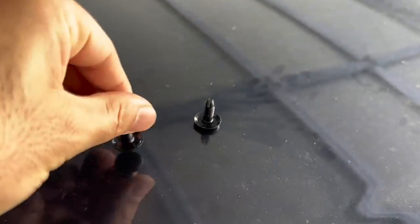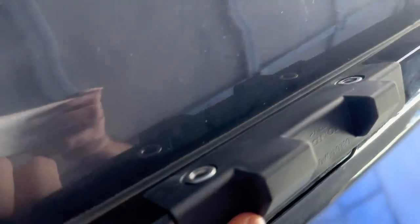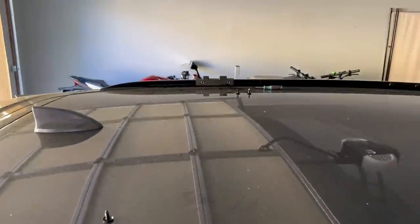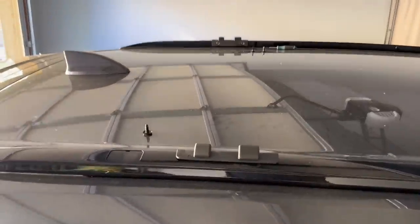To start the installation, we basically remove these little screw cap covers — they're just plastic covers. Then we put our little fitting on as such, this is for the left side, and that's going to go right over there. Then we're going to put the actual Torx metal bolts in here. I'll do that for all four sides and then the roof rails will sit on top. We have this side on and that side on as well. We will now proceed with the bar placement and the Torx screw installation.